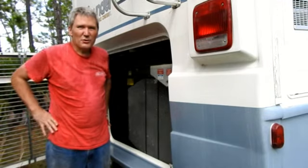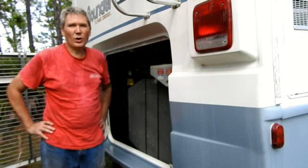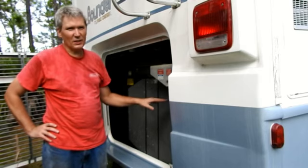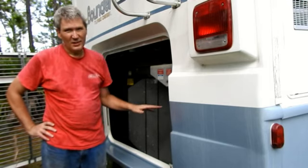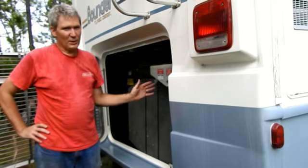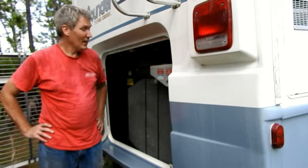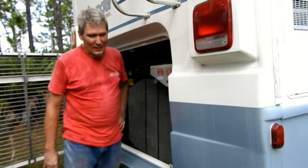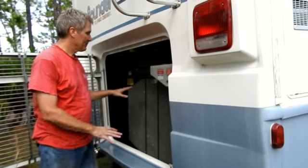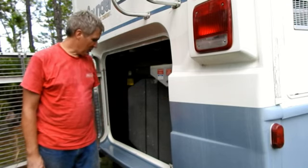Okay, so as I was spraying it out this time, I could actually hear where the water was going through the radiator all the way and hitting the fan blades on the other side, and where it wasn't. So I noticed that a circular or haphazard pattern of spraying just wasn't going to get it. So actually I had to go line by line. I went every single line on each section and sprayed through, trying to clean out as much as I could.